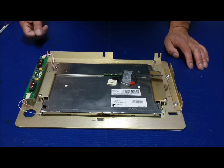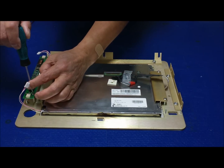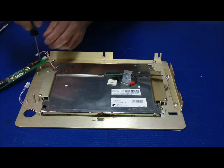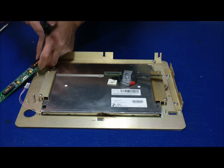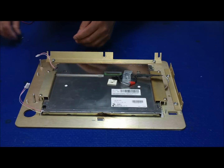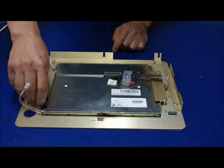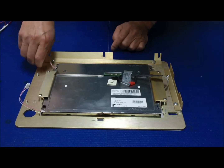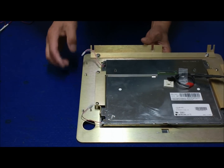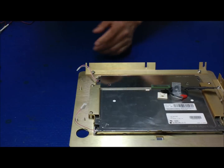This screen has two backlight lamps. First we disconnect the lamp, and we can remove the inverter because we don't need it anymore. Let's take it out and set it aside, and then we can take this port out too so it's easy for us to access the old lamps. The backlight lamp is held by just two small flat head screws. We move the screen and it's easy to pull out.